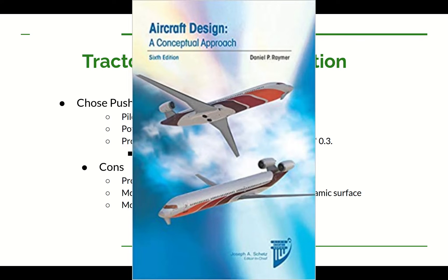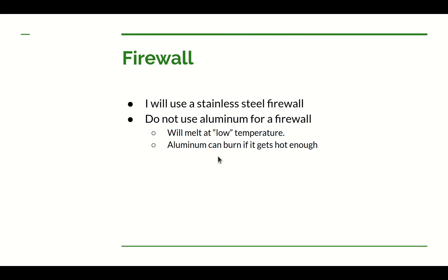There's a link to Dan's big textbook on the Ultralight Airplane Workshop book resources page. As Dan points out, it's really good to have a firewall between the cabin and the engine, since a fuel leak could cause an engine fire. This is critical if the engine is in front of the pilot, but even with a pusher you don't want fire near the pilot, wing, or structure. Dan recommends a steel or stainless steel sheet for the firewall — you really should not use aluminum, because if the fire gets hot enough, aluminum can burn or melt, making the firewall useless. I already have a thin piece of stainless steel — about 0.015 inches thick — that I'll use for the UWS-4 firewall.